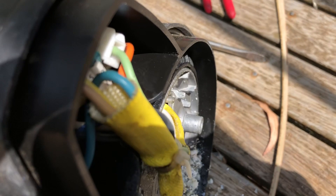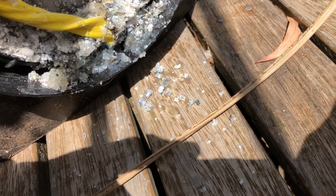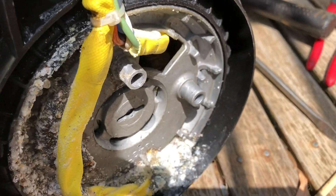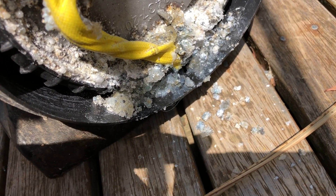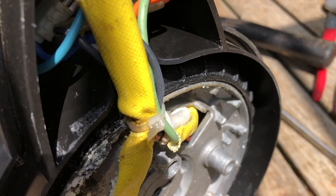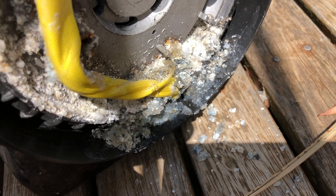If you have a look in here, this motor has gotten water inside. The silencer casing has ended up like its own little private swimming pool and flooded the motor — absolutely filled it with water — and then flooded and corroded it. There's no repairing this one, it's absolutely stuffed and dead.